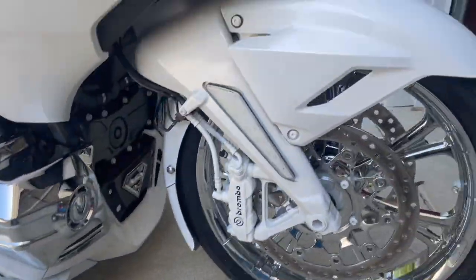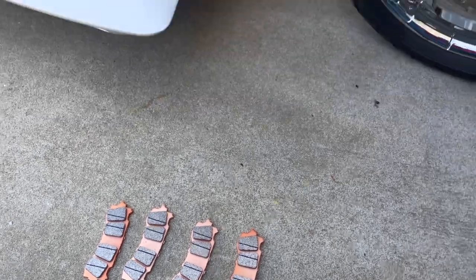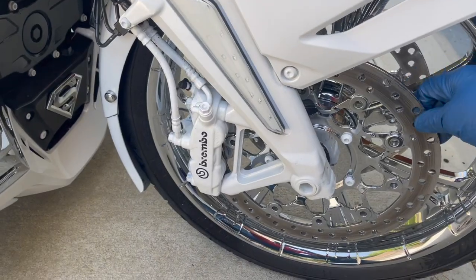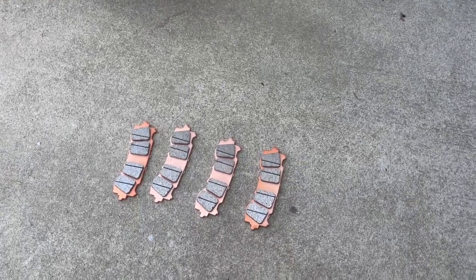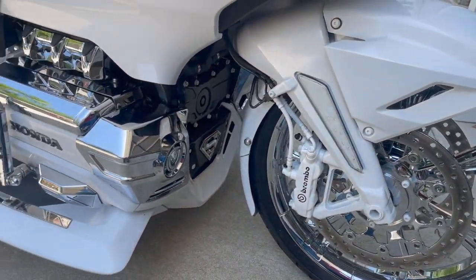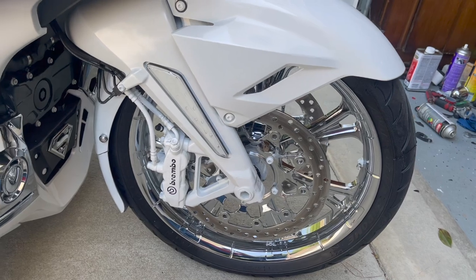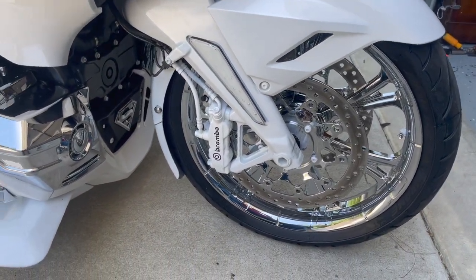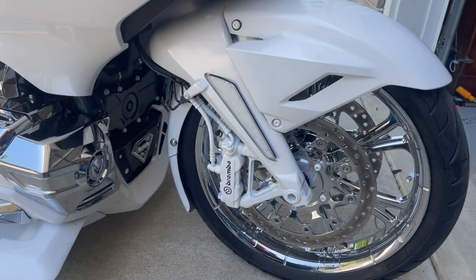Since I already got to clean these brakes where I got that paint on there, I'm going to do the front and the back. I might put some nice brand new brake shoes up there because when I painted and had my rotors chromed, it's got all that chrome off the rotor. So I want fresh, clean rotors with some good nice pads on it. When you're out on that road traveling, I got to be able to stop. Changing brakes is pretty simple — just two little bolts, take them off, press the pistons back, put them in. As long as you don't break the brake line, the brakes are easy. Just make sure you torque them down like you're supposed to.